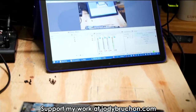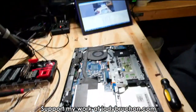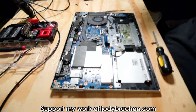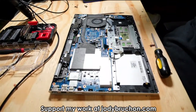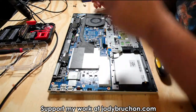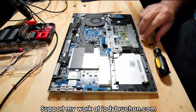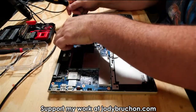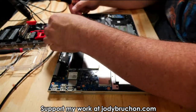CPU intensive? Doesn't have to be. RAM intensive? I'm pretty sure that's 4 gigs of RAM, so no. It doesn't have to be. Now, obviously, if you have more CPU, you can do more stuff. One of the things I can't do with this setup that I can do with a bigger computer is run a browser at the same time and capture live chat, because the browser puts the CPU needs way past what can be handled, and OBS basically just chokes.